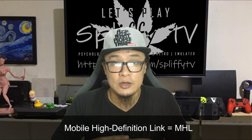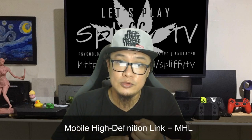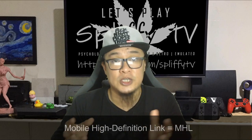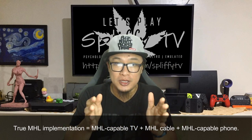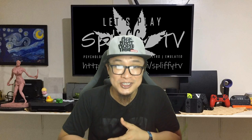Mobile High Definition Link, or MHL, is an industry standard that allows the connection of mobile phones and other portable devices to HDTVs, audio receivers, or projectors. A true implementation of MHL includes an MHL capable TV connected to an MHL cable connected to an MHL capable phone. But nowadays, you can buy cables or adapters that already have MHL capabilities, and you can use the technology even without an MHL capable TV. And some even allow mirroring through an app, so you can use it even without owning an MHL capable phone.